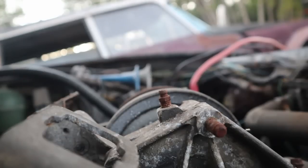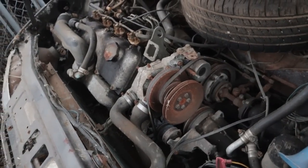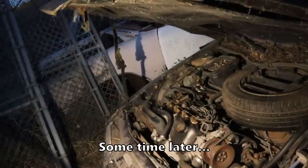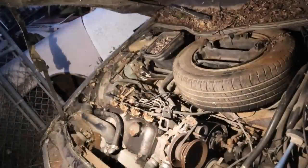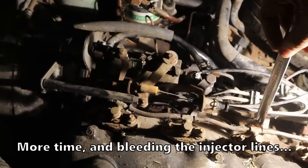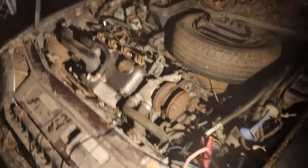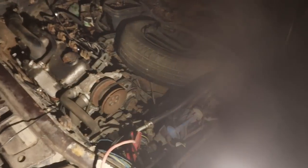Okay. We're going to need some revs on the van. Honestly, it should start if it's got fuel, so I think that we need to find the primer and prime it up. Okay, go. There we go. Okay, stop. I can see it'll at least occasionally now drip. And our starter's smoking now anyway. Smoking in a good way though, right? It's dripping out of at least two of them, where it's not pouring, it's like it'll drip and the line's completely open. Okay. Ready? Yeah.